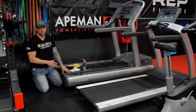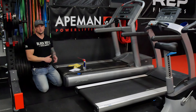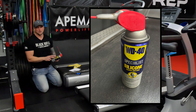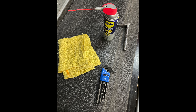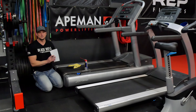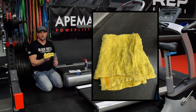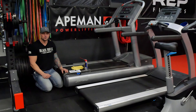The process I'm going to show you on this particular Life Fitness one here would work with other Life Fitness, Precor, or Matrix brands — they're all very similar in the way that they adjust. You can also get a ratchet and then an Allen socket set up like this, and I like this better — I'll show you why in a minute. Most treadmills are going to use 100% silicone type lubricant, so make sure that you read your manual and find out what kind you need. You're better off to do nothing than put the wrong lubricant on it. You'll also want a piece of paper and a pen to jot down some measurements, a small ruler or tape measure, and a rag.